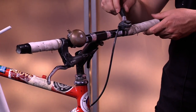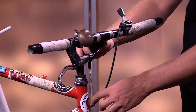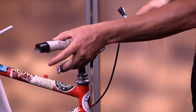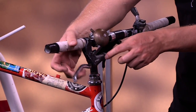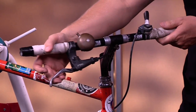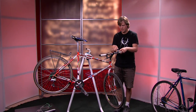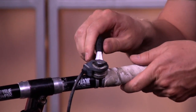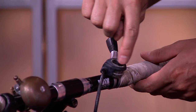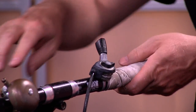On this side here is called your brake lever, and its only job is to pull cable. Everything on a bicycle is actuated by cable on most bikes. There are electronic bicycle components now, and there are even some hydraulic parts. But on this old bike, and most bikes you see around Davis, they're going to be actuated by cable. So this lever is just pulling cable. When I pull this, it actually pulls this cable up and pulls the brake. This is also a shift lever right here — called a thumb shift lever because you use your thumb. The whole idea behind it is just to pull cable, wrapping it around the circular part here. When you pull cable, you're pulling the derailleur on the other side. You have your brake handle and you have your shifter.